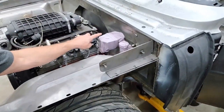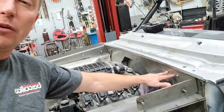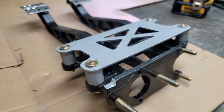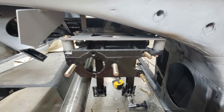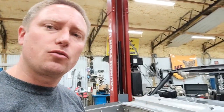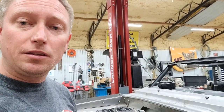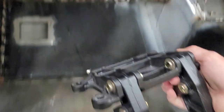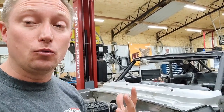We've talked about how I made the mounting plate that grafts into the firewall — you saw that in the pictures earlier. Now comes the hard part. I'm going to show you a few photos where the firewall is not yet in the car. You can see that I have custom CNC-cut some plates that go in the car. I ultimately ended up designing those plates by using cardboard pieces that I was carefully trimming with scissors until I found something that actually works. I made some custom plates, welded those into the car, then welded the firewall into place, and ultimately I have the pedal box bolted to both the firewall as well as the bottom side of the cowl, so it is extremely rigid.